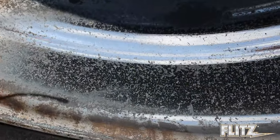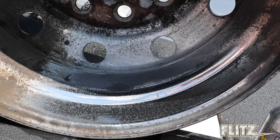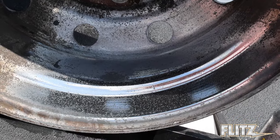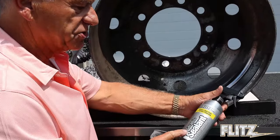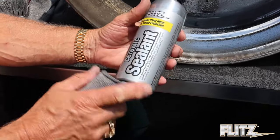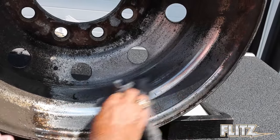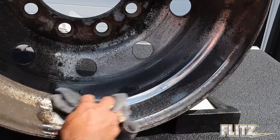The pit marks are something that won't come out unless you sand it, but the luster is amazing. When you put water on top, it will bead up and protect for two to three months in salt water and four to five months in fresh water. We also offer a longer protective coating called the ceramic sealant from Flitz. For those familiar with ceramics, you can use it on paint and fiberglass. Our ceramic coating is a do-it-yourself type — you simply spray it on, it looks like water, and all you do is take a microfiber and dry it off. It takes two hours to cure, and after that it gets super hard, giving you up to a year of protection.